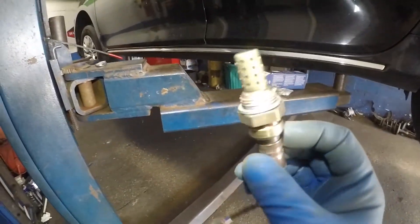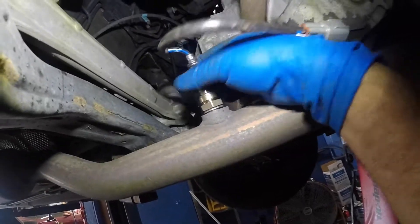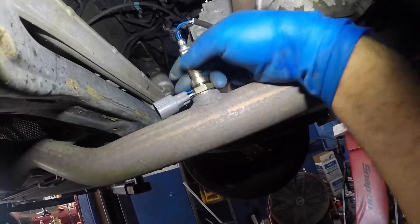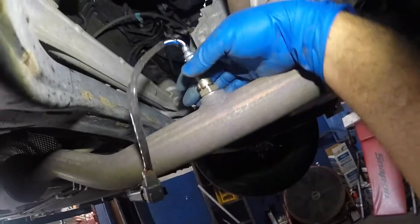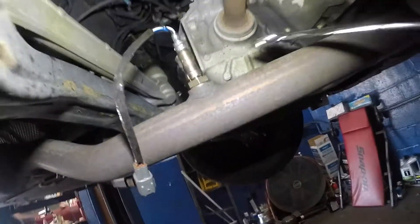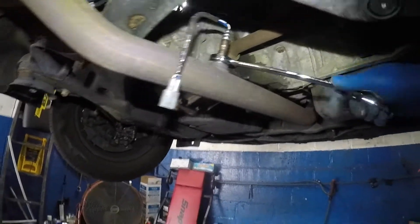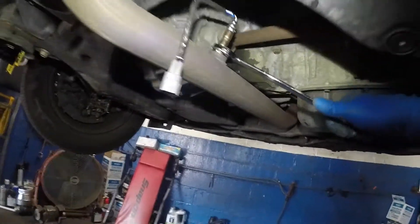It's all nice and good — got the NTC in. Let's go to the vehicle. Going underneath here with my knee pad on the floor. You don't need to do anything else — just take this sensor and stick it in, get it caught up with the threads. After this you want to either torque it or, if you don't have a torque wrench, just take your 22 millimeter and snug it. This is usually around 33 foot-pounds. Mechanic hand — perfect.